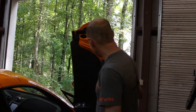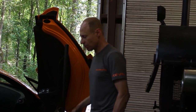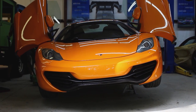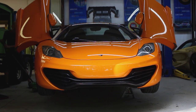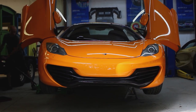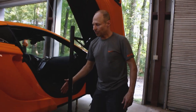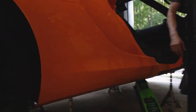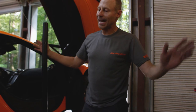The opposite side of the car is just the opposite — we're going to find the same jack point on the corner of our carbon tub, jack it up, but go to a higher point this time. I like to do it with the doors open; it makes it easier to reference and find that spot, and make sure I'm not putting any pressure on the painted portions of the car. That's step two — we've jacked up the second side of the car and put it on the higher setting. You can see we're on the jack points for our jack stands. We'll slowly release, put the car down, level those stands, and now we can work on this car.